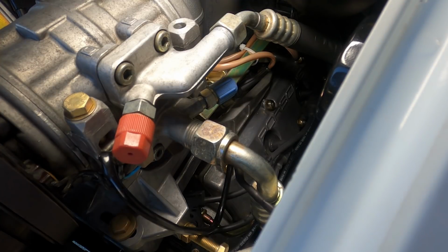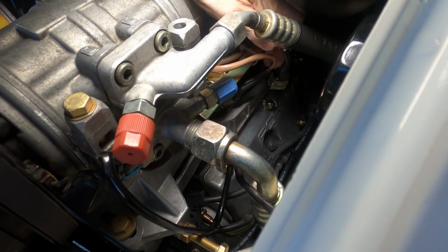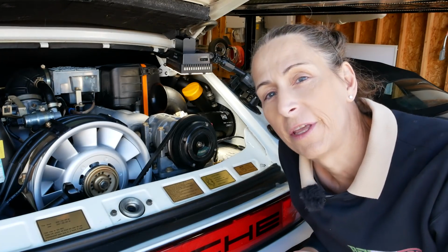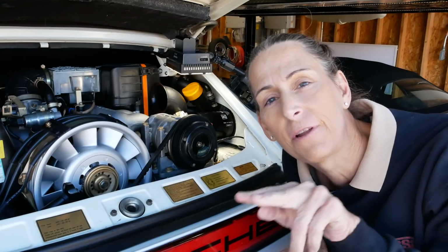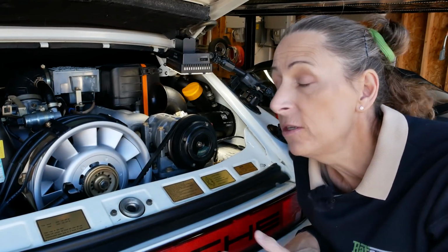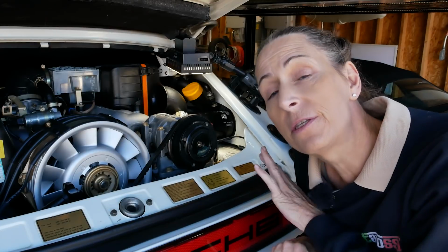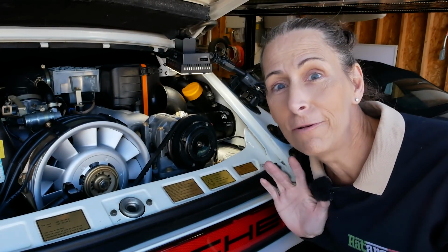So all we do is just wiggle our connector off here. There we go. Get that off. Set that guy up there like that. Funny enough, it wasn't the Bosch one that fit, it was the GM one. So that's kind of weird, huh? But it needed to have flat pins, and that's one of the nice things about buying a whole set like that. This is an older car, so maybe the new Bosch injectors have just straight round pins on them, but this is an older car. So, I don't know, you've got a bunch of them to choose from. It looks like the GM one was the one that fit.